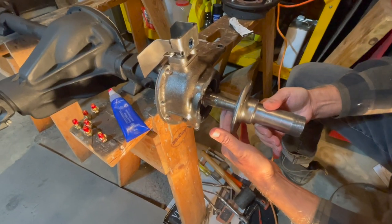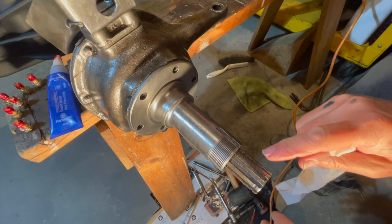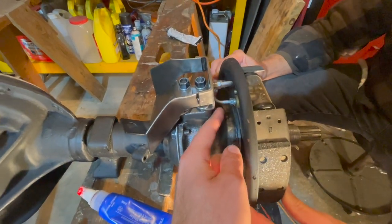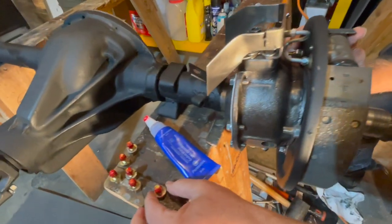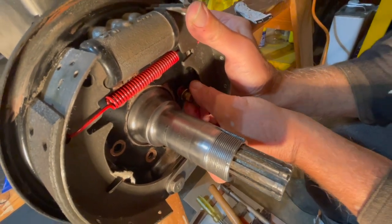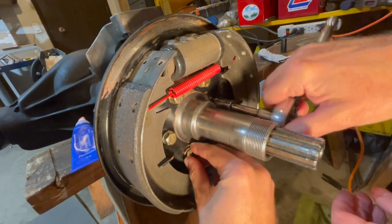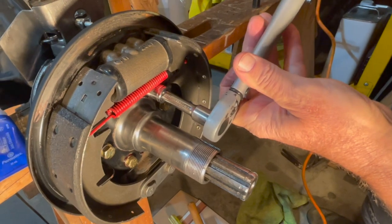Slide the spindle onto where the gasket maker was applied and gently line up the holes. Mount the spindle with the slot for the hub washer generally on the upside. Install the brake backing plate with the hose facing upwards and push it onto the spindle, lining up all the holes. Thread the bolts — which already have gasket maker and lock washers applied — right through, starting on one side and working around to install all bolts. Snug them up with a ratchet, then torque to 30 foot pounds in a crisscross pattern to evenly distribute pressure.